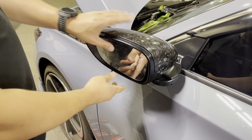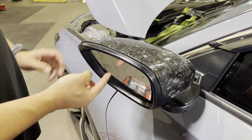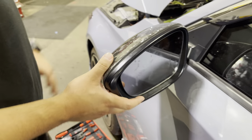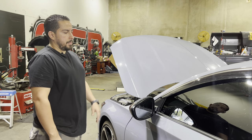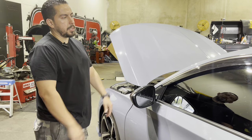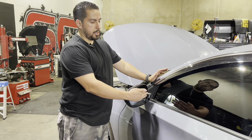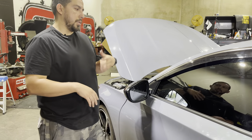I've done one before on a Civic where it makes that noise going up and down, but when you go side to side it went very freely — that means the tooth or thread wasn't back inside the part where it needs to grab. After you put everything back on, we're going to wipe it down. Don't forget to reconnect your battery. On 10th Gen Accords and Civics, when you reconnect the battery, all the lights are going to come on your dash because the system is resetting — usually just drive around the block and the calibration resets itself. When we reconnect the battery and turn on the car, make sure these lights still light back up and that both mirrors tilt up, down and side to side with the controls. If they didn't, then you didn't do one of the steps correctly — just go back and check your work.